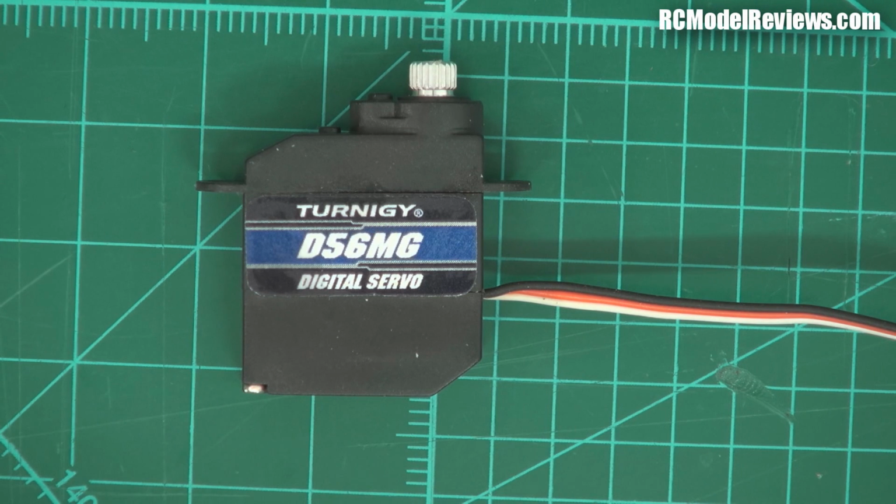Also, because the rudder is right at the back, if you do a cartwheel or something, or you have a bit of an accident carrying the model around, the rudder will quite easily be banged quite sharply. And that force will be transferred through the pushrod to the servo. Plastic geared servos tend to strip quite easily. I've already stripped several gears on some of my other DLGs doing cartwheels, and then you've got to replace them. So I figured we'll use a metal geared servo, which should have more torque, and the gears should be more robust, so hopefully we won't have to ever replace them.